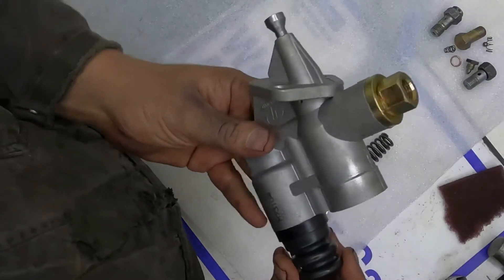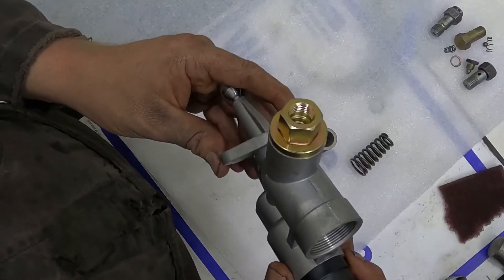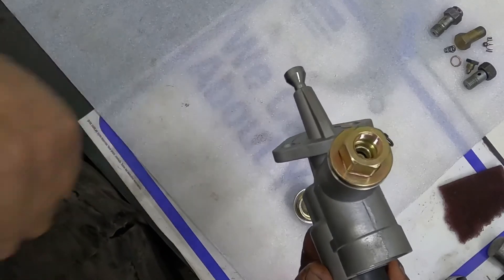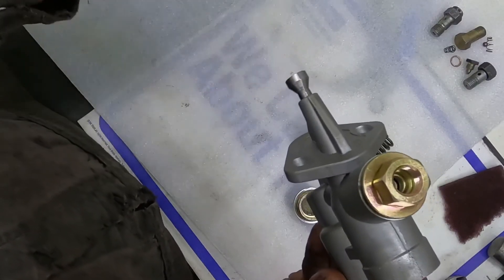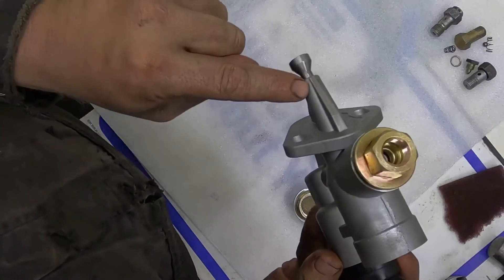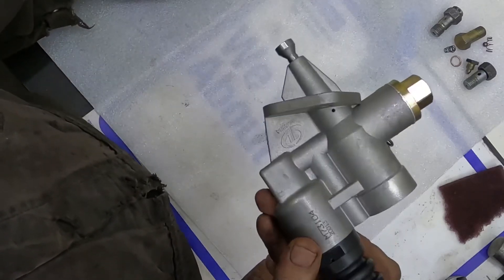One thing: if you are pulling this off, there's usually a fuel heater here that bolts to the engine as well, and there's a plate that goes in between here. If you're going to pull that fuel heater out completely, you need to put a spacer in there. Otherwise this does not have enough travel and you'll actually wreck the lobe on the camshaft and/or the pump. The pump's cheap — it wrecks it — but it wrecks the lobe on the camshaft, and then you don't have much of an option and you're doing an electric lift pump.